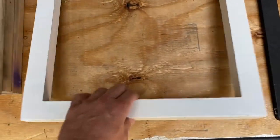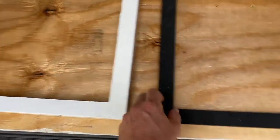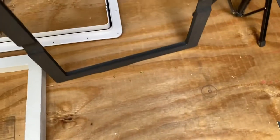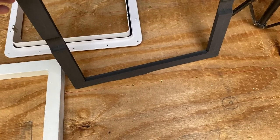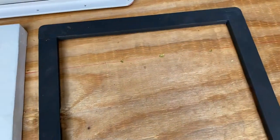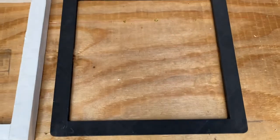So as you can see, these go together pretty simply. This goes underneath the van. This is a gasket that goes on top, a spacer to go on top, and it has a cutout specifically for the rib in the van. You can get these for 3 different locations. So this one is for the rearmost section, and I'll show you how that goes.